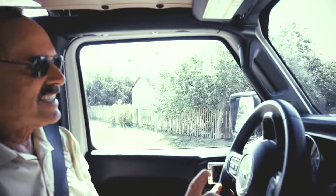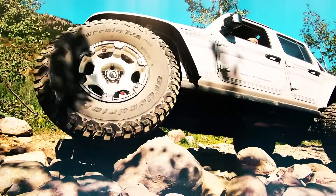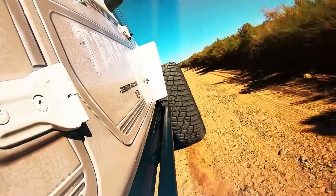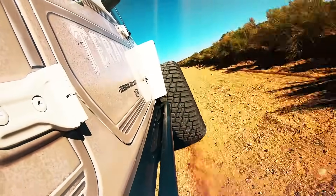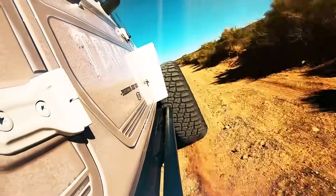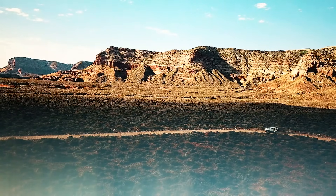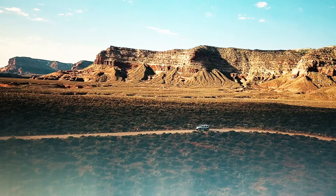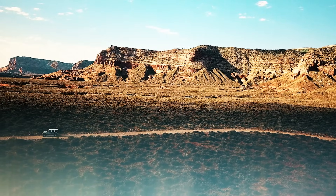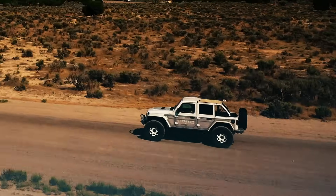But there's one thing that all of us need to understand: tire pressure. If you think you're going to put an E-rated one-ton truck tire on your Jeep and run 60 pounds of air in the tire, I don't care whose shock or what you do, it's going to ride like a dump truck. So back off on the air pressure. You've got big tires on your Jeep — they don't need that much air in them. People run them anywhere between 25 to 30 psi. People who think they've got to have more can go up to 32, but you don't need any more. The tire is going to take the sharp edges off and that's going to let the shock do its work.